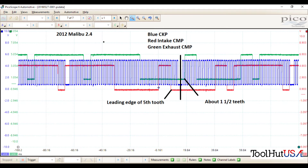I know for a fact working on these that it takes about three teeth for them to start triggering any kind of codes — we're obviously not three teeth off. But the interesting thing is that it looks like we're getting closer together between the cams, and that tells me that we've got some slack between the chains. My suspicion is that the guide on or underneath the valve cover has broken or worn out substantially.